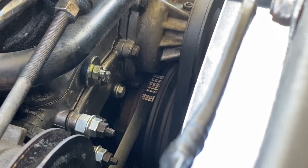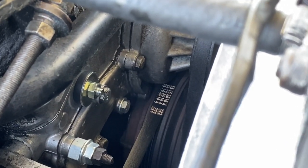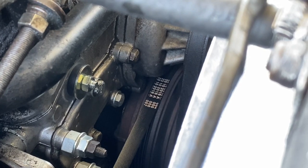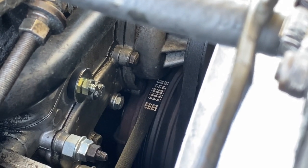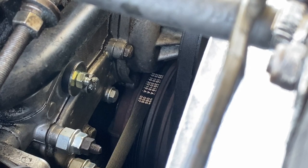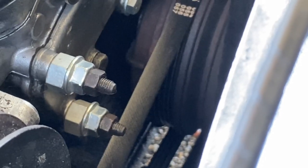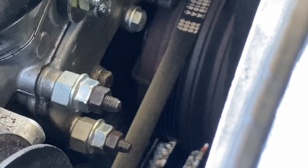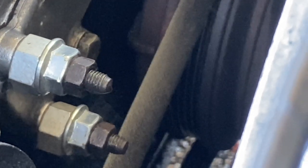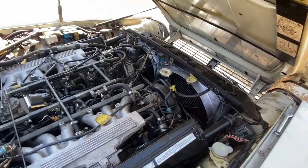I deleted the hub that was on there. You can see these screws right underneath that little plug I put there — those original screws are much longer because there was a hub in place. I found common threaded screws, cut them down, and put them back in place. The other two are studs. Some people talk about putting spacers, but with the quarantine I minimized my exposure, so I just took two nuts, fit them around there, and torqued them down with the existing bolts. The water pump has not leaked.